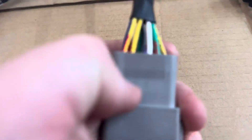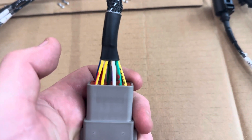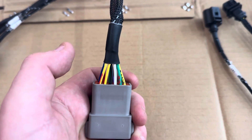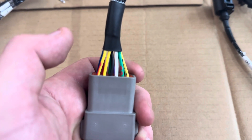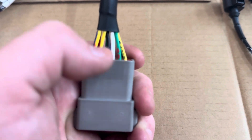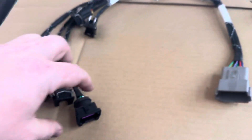If you flip it over to the other side, you will have yellow, yellow — those are your 12-volt ignition wires, which should have a 12-hot taken from your main harness with the key on. The next three wires, black, white, green — those are your cam sensor wires.